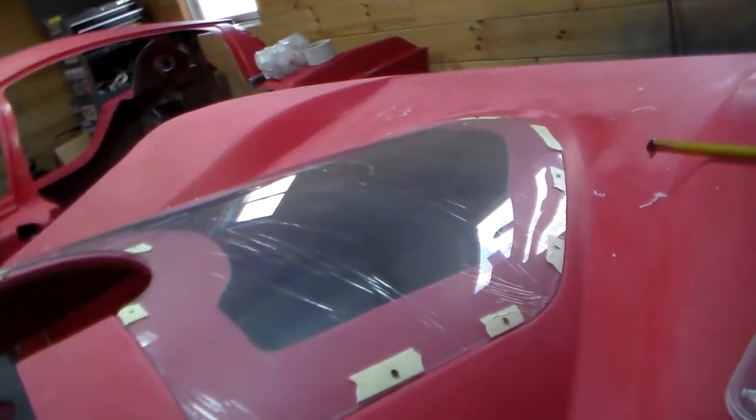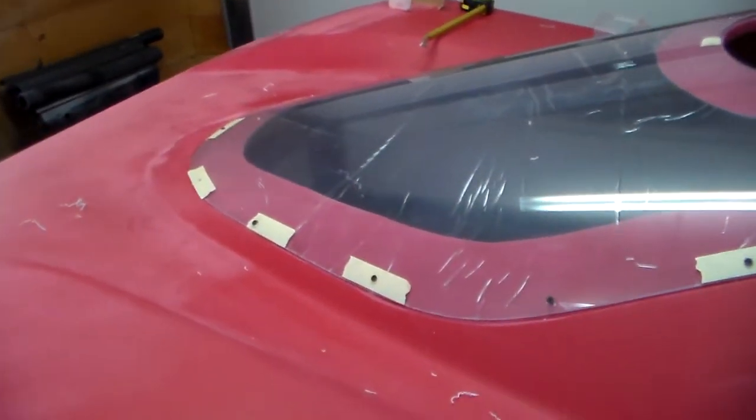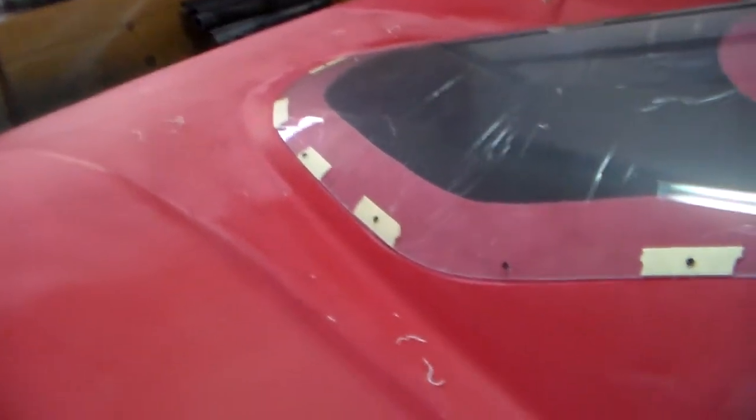The rear window is ready to go. The tail is basically ready for prime now — just got to do the cutouts in the wheel wells marked with the jigsaw on both sides, and the cutouts for the tail lights which are already indented in the body. This area here is going to come out, but the tail is all set to go, sanded out real nice. There was maybe an eighth of a teaspoon of body filler used — that's how good these bodies are.